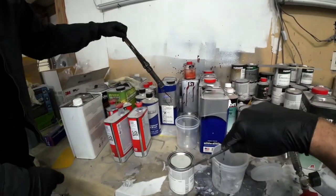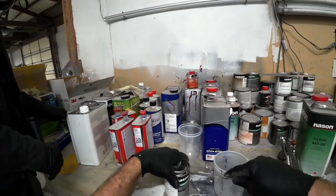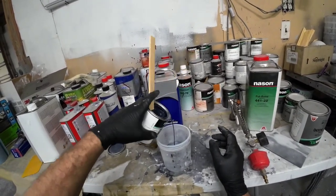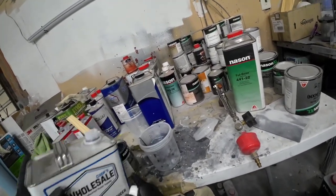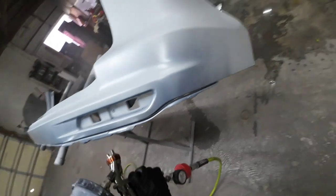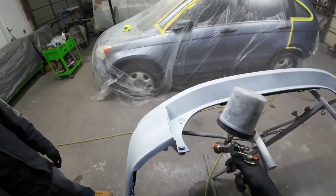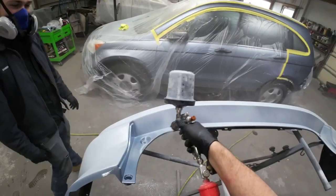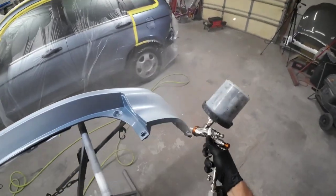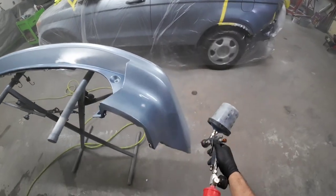Let's mix up the paint. The paint I'm using today is the Nason XL, pre-mixed by O'Reilly's. I find it has a very good color match, is very blendable, and is reasonably priced. This paint mixes up two to one — I'll find the two-to-one ratio on the mixing cup, put in the paint, then one part reducer. Before applying base coat, make sure you give your sealer adequate time to cure. Those solvents need to evaporate out of the sealer before you seal over it. If they're still evaporating, you're going to cause issues. It's about 65 degrees in the shop today, so we waited about 15 minutes for the sealer to flash off.